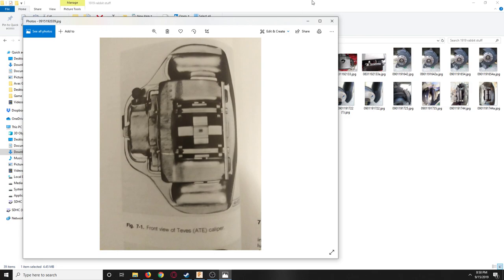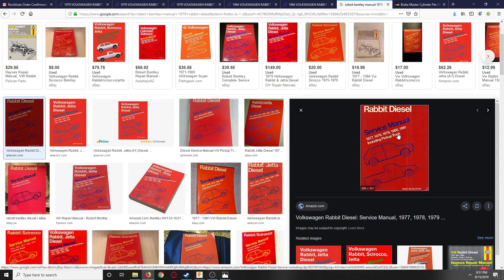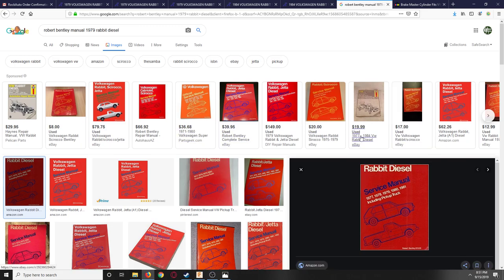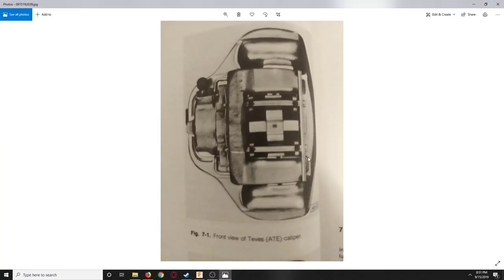This information is from the Bentley book, which I highly suggest you get — diesel or gas version. The brake pads are the same for pretty much all Mark 1s, whether gas or diesel, Caddy or regular Rabbit. The most popular brake caliper on the German-made cars is called ATE, otherwise known as the Teves. The easiest way to identify it is that it has a slope or curved casting around it.